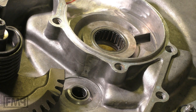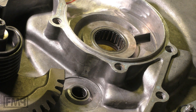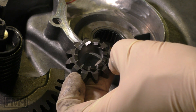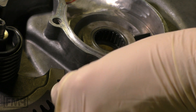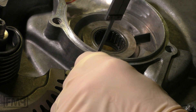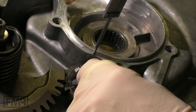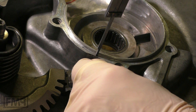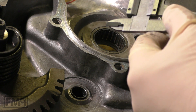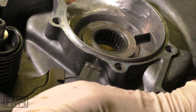There is a weak spot on the small engine half, and it's here. It's needed for the kickstarter sprocket, which sits here. And here is the primary. For that reason this area gets a little bit smaller here, and the problem is that this can be three millimeters down to 1.5 millimeters. 1.5 millimeters is as good as nothing. So let's measure how much we have here.